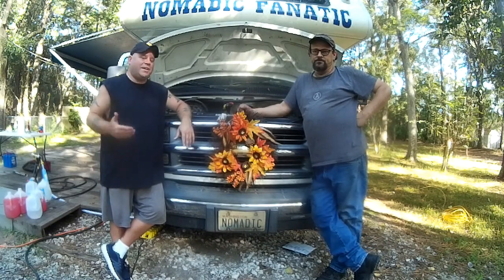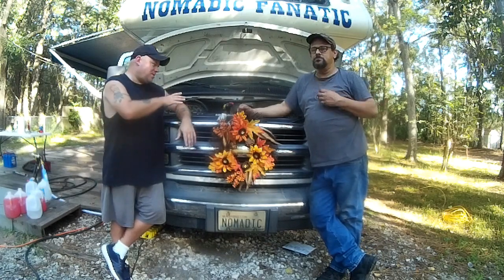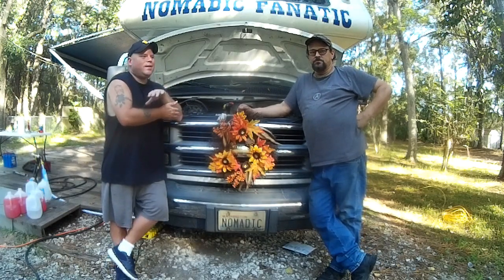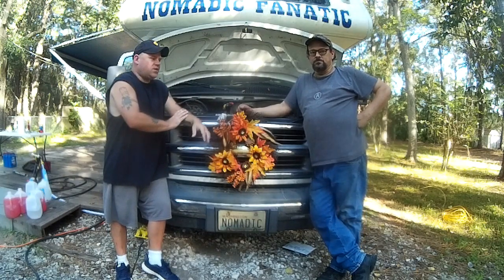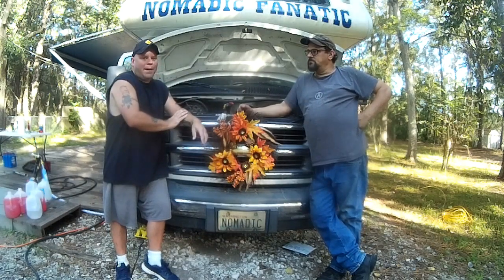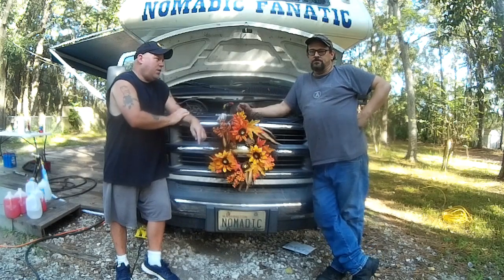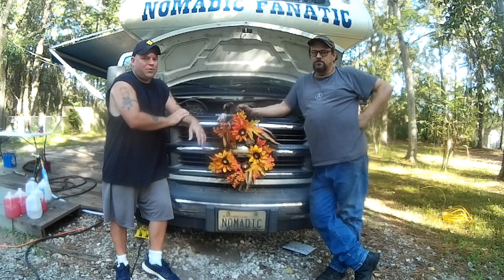If it sits overnight, it always fires right up, but this fuel problem, we put the tester in there to try to test for pressure, and it slips down. So I've done a bunch of stuff to try to fix this problem, and we just finished the fuel pump about a month ago, and then I got here to Wayne's and we put the pressure tester in, and we basically came to the conclusion that it had to be a leaky injector or faulty fuel pressure regulator.